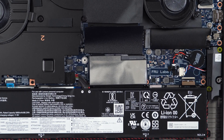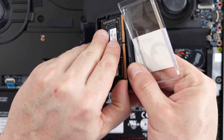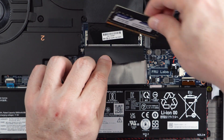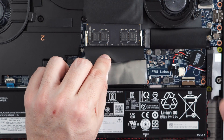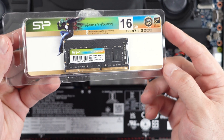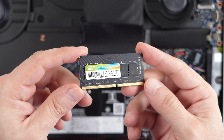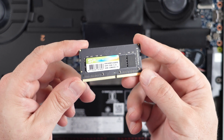So the next thing we want to do here is install both memory modules. This is the first one — it's a 16 gigabyte DDR4 memory stick from TimeTech. And the next one is another 16 gigabyte from SP; they're both DDR4-3200 CL22. Although not ideal to use different memory manufacturers, they will work. I know that these brands play well with each other. Given the COVID shortages, it's whatever we can get our hands on.